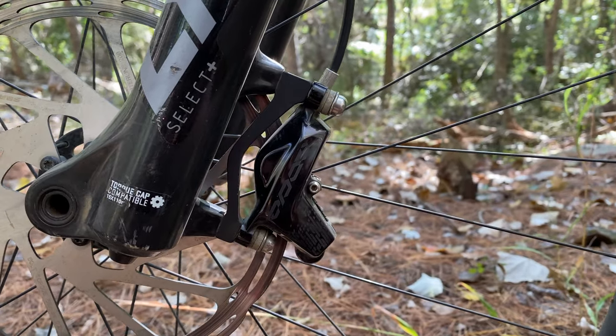Not all brands of brake pads are created equal — work out with your local bike shop or online retailer which are the best recommended or most powerful. Whenever you get a fresh set of brake pads or new rotors, it's really crucial that you bed them in properly. This is the process of transferring a film from the brake pads onto the rotor to fill in any imperfections.